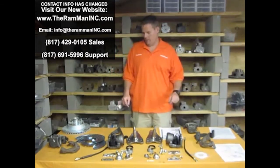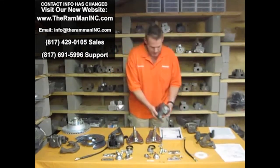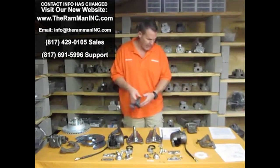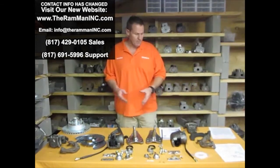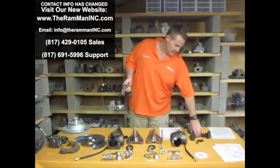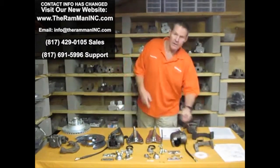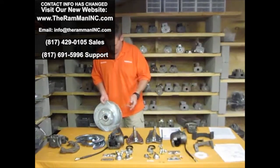If you can pick a specific year you might as well pick the best one. Our kit consists of factory Chrysler duplicates of 1976 A-body components from the spindles out. Our kits include everything from the factory parts manual. It is a sliding-type system where the calipers slide back and forth on machined ways — this is called a sliding caliper type system. These factory setups ran 11-inch rotors. One nice thing about the factory Chrysler components is they can be swapped and interchanged for different scenarios.